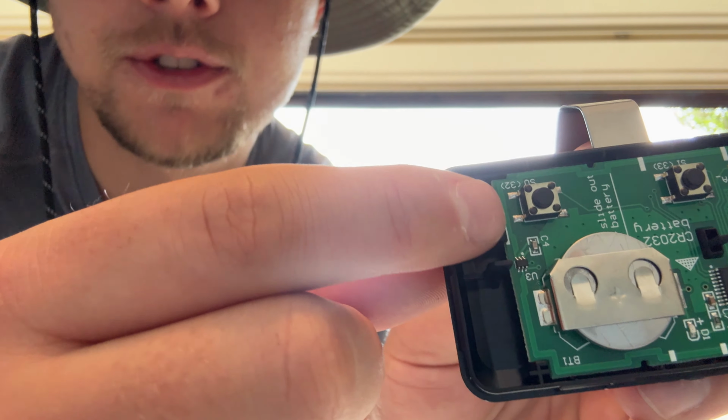You are able to hook your garage door opener up to your Auxbeam switch. That is awesome. Like I said, this was all theoretical. I didn't even know if that plate at the bottom of that chip was negative. I took a chance. I just assumed because the bottom of that battery was negative. But it worked. So now my garage opens with my Auxbeam switch. Make sure you get a momentary switch so that you can just push it, activate the garage or whatever, and let off.